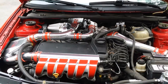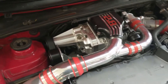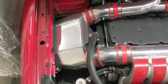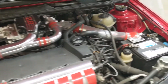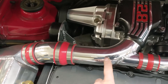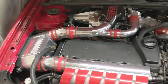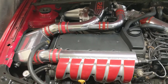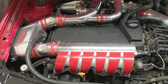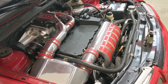So I'll go for a road test and see how it goes. I made a decision - what happened before was I had the two and a half inch intercooler, which was smaller. After the road test, I noticed it didn't have as much power as before. So I left the two and a half inch and went back to the three inch intercooler. I still have good throttle response, it runs good, and I'm happy with the results. The only thing is next I'm going to change the intake - I find this intake is not very good at high RPMs. I'm going to try to make another intake this winter and we'll keep you up to date.